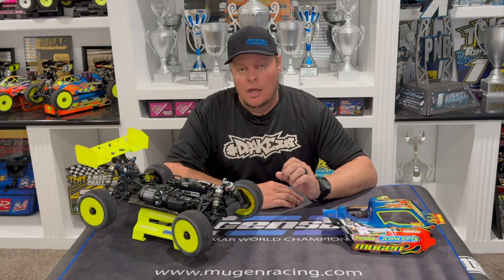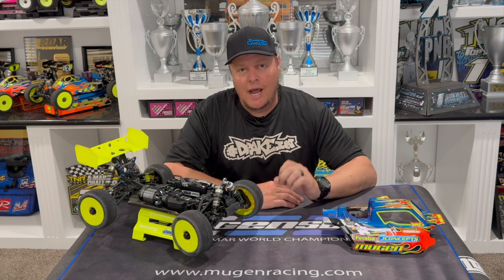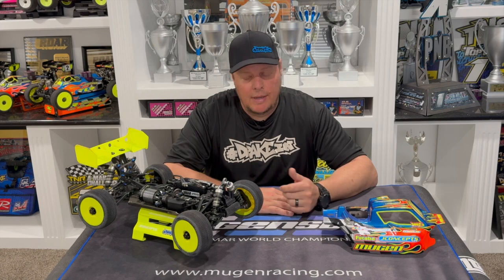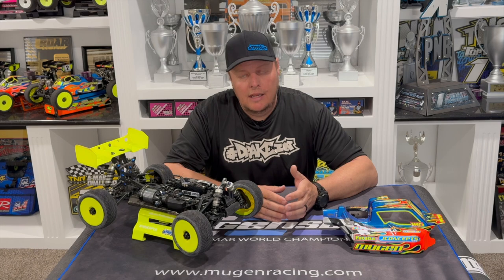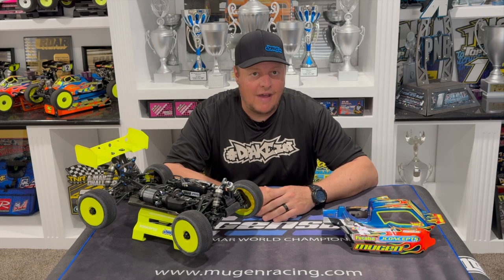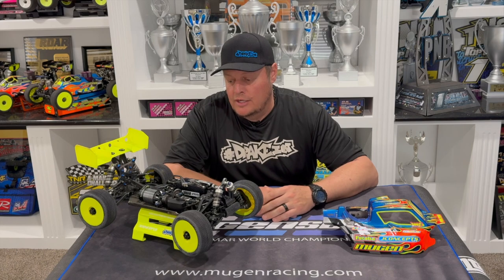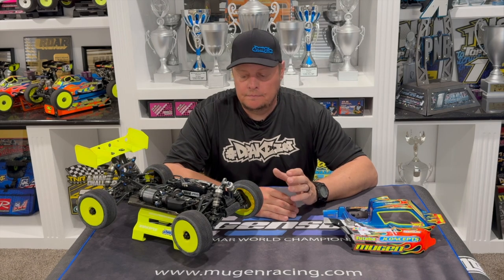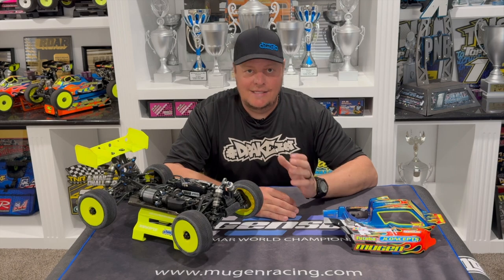Boost is going to be for the bottom end — that short burst. That's why on truck I run five degrees where on buggy I run zero. If you're on a track that's really high grip and you need a little bit extra power, you can always increase that for buggy, though I don't think you'd ever really want to go much above five on buggy. Typically on buggy we struggle to put the power to the ground, especially running a 2200, so I like running zero because it helps smooth out that initial power. Then with the turbo running at 10, it gives that little bit of extra power on the straightaway without overpowering it and making it hard to drive.